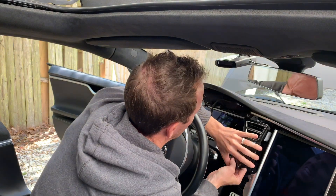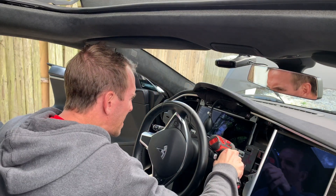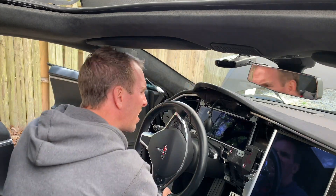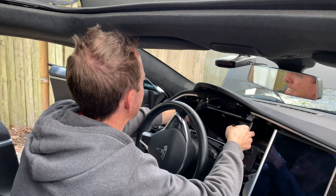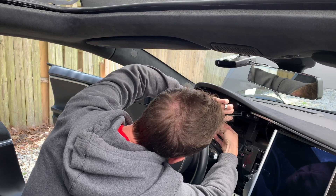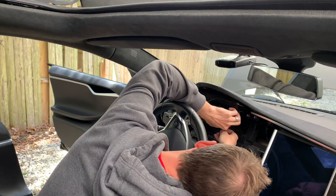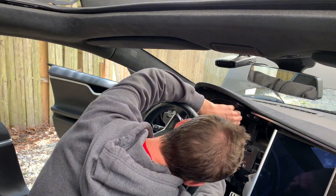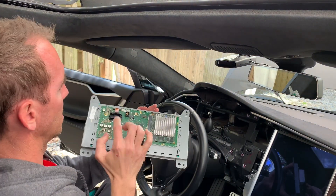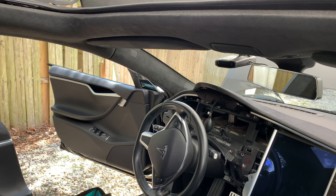This one's fairly hard to pull off. Now I'm pointing out the four screws that would normally hold on the instrument cluster. I've already taken off the top two; now remove the bottom two and the instrument cluster is ready to slide out. From here you're going to remove the two clips — one is a push-button clip with a rotating tab for the larger clip, and for the smaller one it looks kind of like a coax cable, just a small push-button clip. And that's it — you've got your instrument cluster out.